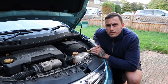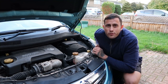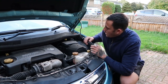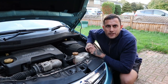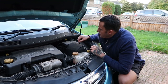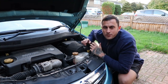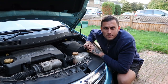So from that check I haven't got a battery drain. In sleep mode my car's at four milliamps — you don't want to see more than 50 milliamps. If you do, chances are you've got a battery drain somewhere. The next step would be to go across the fuses and check the voltage drop — you'll see that in a future video, so like and subscribe. Most people like to just pull the fuses out until they see the amperage drop, but I don't think that's a good idea, especially on modern cars — it could do further damage.